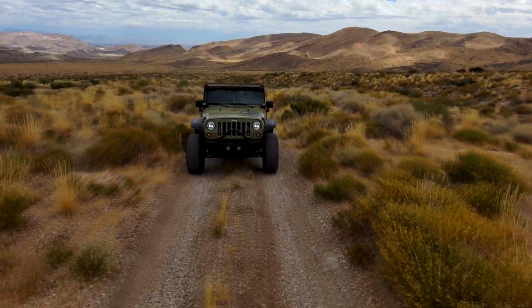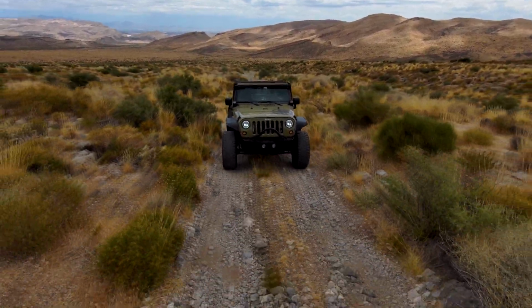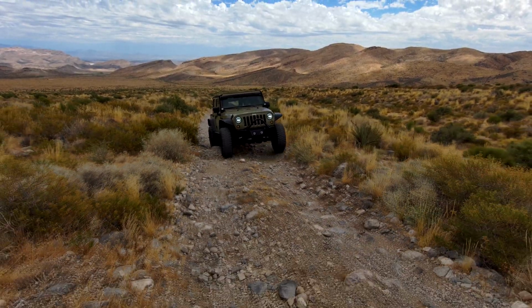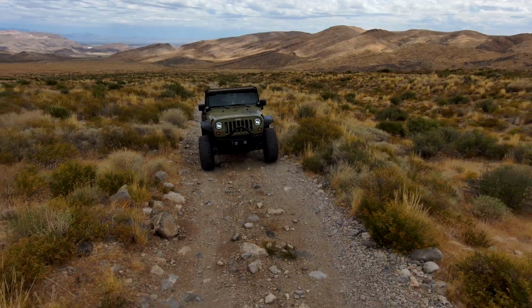The Motec quad-header radiator runs 2 headers on each side, like a Caterpillar tractor. And then we beefed up the tube. And then we took all the strapping and gussets and everything else off to allow the radiator to flex with the vehicle. And that was a problem.